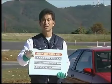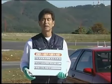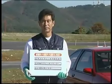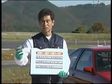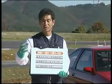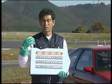I like the linear feeling, but you might prefer ones that need hard braking to get it working, like the Super Sports brake pads. So, choose the right pads depending on your style and the front tire grip. Doing nothing to the rear won't get you anywhere. I assure you, you'll have a hard time in the corners.